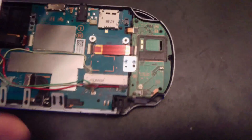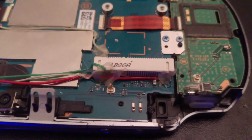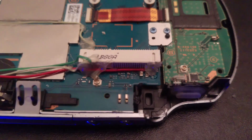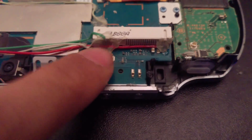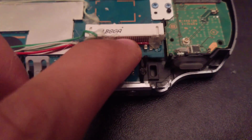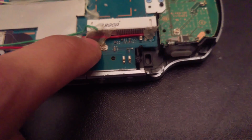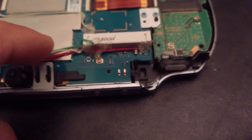The first part is the USB minus positive terminal. As you can see, the way I've soldered these — the line comes top down. So instead of being soldered directly to the bottom pin, it comes down on these lines. I found it easier than doing those pins because having it up and bent already was easier for me.